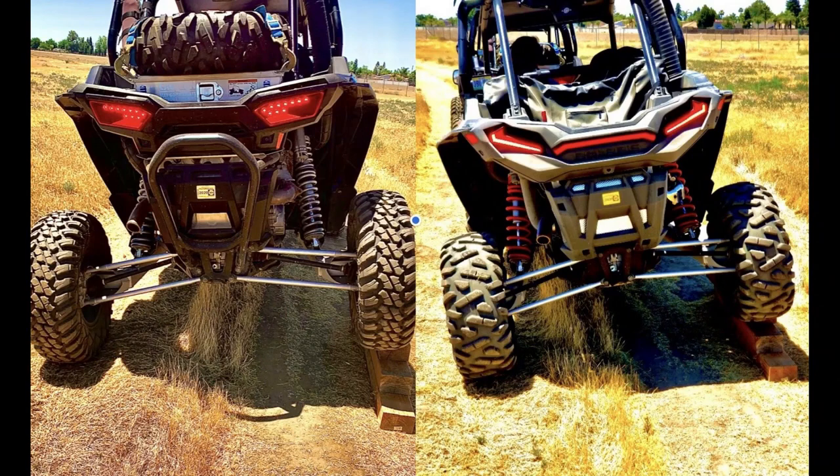So why is articulation important to an off-road vehicle? It improves traction. The more tire surface you can keep flat on the ground, the more traction you have. If you look at the picture on the screen now, the RZR on the right is all stock suspension. It's sitting on a 12-inch stack of boards. The machine is canted to the left severely. The camber of the tires has changed, the radius rods are at a really weird angle, and the machine is off balance.